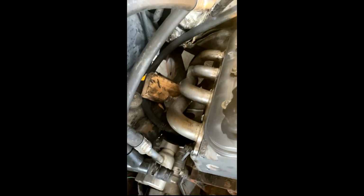All right, day 10. So I've got this head fully bolted on and torqued and everything, because this header, I was able to get out of my way enough to get to the bolts. And so I've been fighting this driver side header. The problem is that my headers are welded to the exhaust system, so I can't just unbolt it and move it. So I use Big Daddy Sawzall over there, and unfortunately, as you can see, I had to cut the header off the exhaust. So we'll put a little clamp on it and take it to the exhaust shop and have them re-weld it back together.